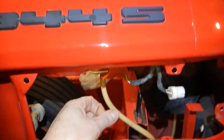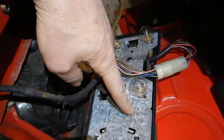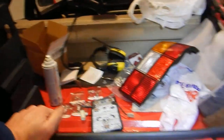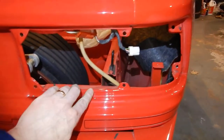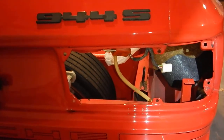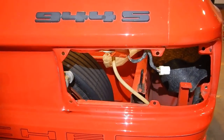I'm going to put the housing back in through here. You don't have to remove the drain tube if you do it this way. If you're only changing your bulbs, you do have to remove the tube on this side, otherwise you can't get the light bulb housing out. I think putting these seals on is a good investment — it's 20 bucks, it's going to be about two and a half hours, and I'm never going to have to worry about water leaking in around the tail light housing. Hopefully this video helps you speed up the process and gives you a little confidence — it's not a hard job, it just takes a little time.